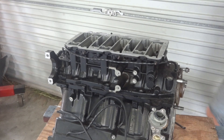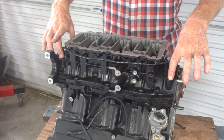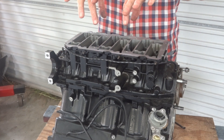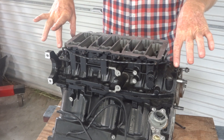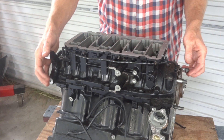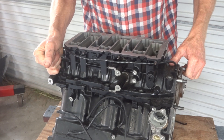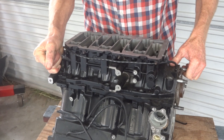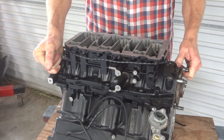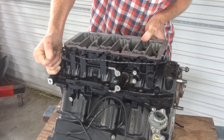Engine is now upside down. I've taken out all the big bolts, which are basically main bearing bolts - four in there, four there. There are little half-inch bolts on the outside. Giving this a thump with a hammer, and I think it's going to come off. Feels like it wants to.